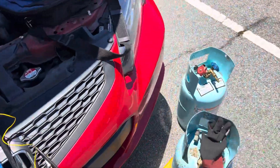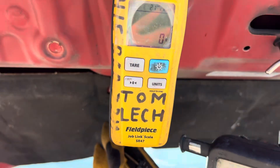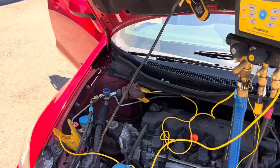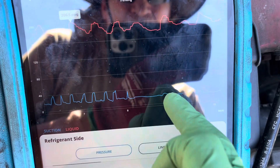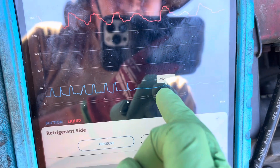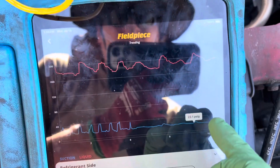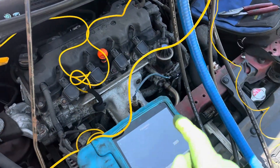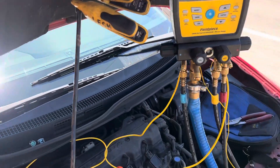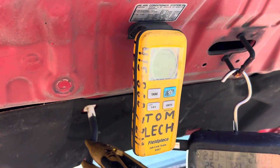My scales are at 30 grams — let me zero them out. Now let's start putting in that other 100 grams. You can see the little tiny blip right there where it turned off. You can see it's constantly running, but the high side even under this load is not going any higher than when it was in the closed cooler cabin in recycle mode.